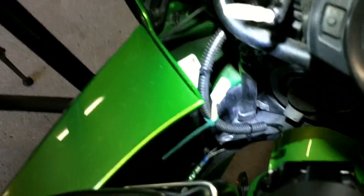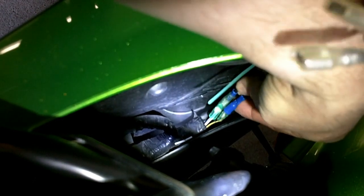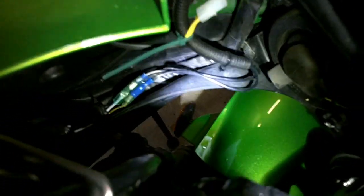Here's a better view of what's going on in here. This is on the left side of the bike. You'll see these two wires right down here — you've got a blue and white and a black and yellow. The black and yellow is your ground and your blue and white is your positive 12 volt. I made this little wiring harness and wrapped it just to give it some protection. You'll also see this white box — it's just velcroed to the inside. That's where the garage door opener module is.